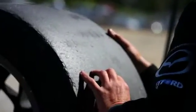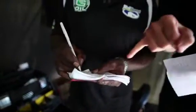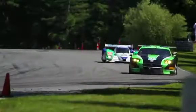You've got several counter-opposing limitations — you're quite over-constrained as engineers, having to tick all these boxes to the tyre's satisfaction. And that's the key: the tyre. Ultimately the tyre is the only bit of the car in contact with the road, and you've got to keep those tyres happy with good contact patch area and minimum load variation. It's all damping, springs, bump rubbers — a myriad of contravening requirements. It's a balancing act between aero, mechanical grip, and driver feel — that variety of factors is how you come up with a setup.